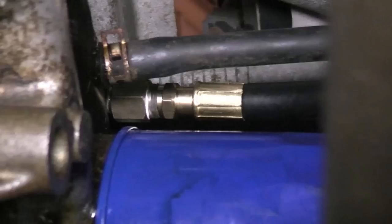You want to warm your vehicle up before taking your pressure readings. The pressure will always be higher when the engine and oil are cold. The pressure specs will vary from vehicle to vehicle, so check your service manual.